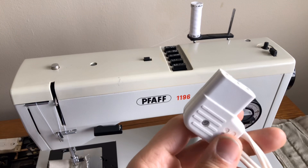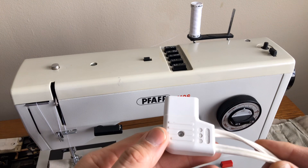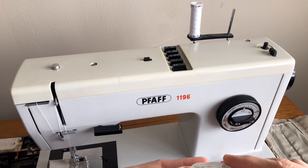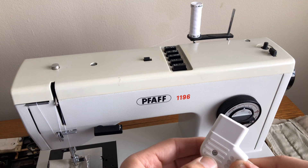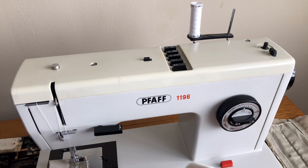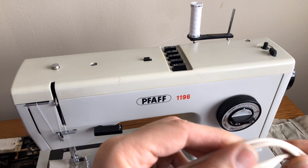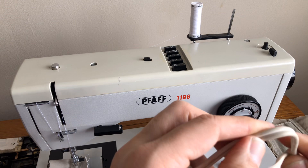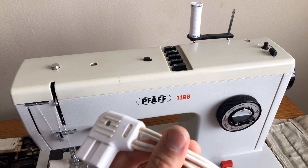When you're looking at cords, look at the plug carefully. The plug is made of hard plastic — check it for cracks, make sure any set screws are present and it's not going to fall apart. You can plug it in and make sure it fits snugly and doesn't slip off. I told the client: the good news is your cord is in great shape. The European companies were among the first to use a different material for cord coverings — it may have some silicone in it — and it's proven to be quite durable compared to old rubber or vinyl. You still want to check for any cuts or abrasions.